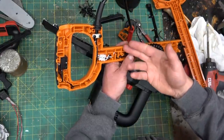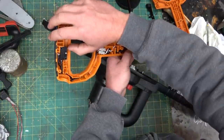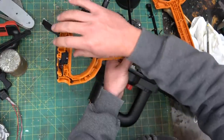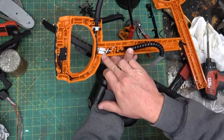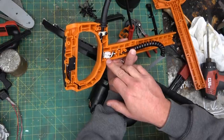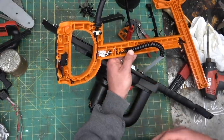Speaking of the handle, a little surprise in here. Well, we've got the regular strain relief. We've got the handle. We've got a micro switch. Actually got a heavy detent. It doesn't feel like a micro switch, even though it just has the nub of a micro switch. That feels like a proper switch. I didn't think these were legal in 120 volt systems, with the plastic encased chintzy little, what do you call that, terminal straps.